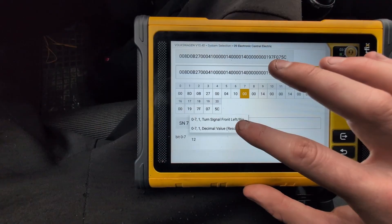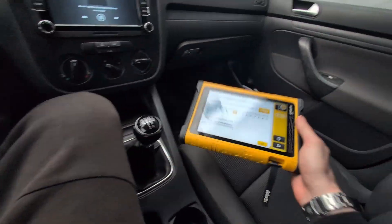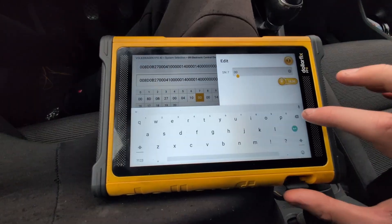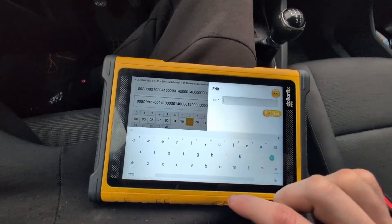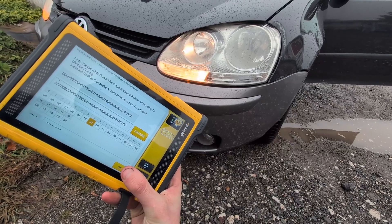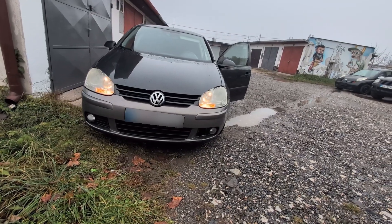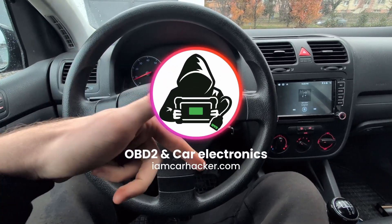Last modification will be in byte 7 — this makes US-style turn signals, so the turn signals will be on permanently. Let me show you my turn signals first. In this coding, what we have to do is change the byte value: 32 means brightness at 50% and 64 means brightness at 100%. For demonstration, let's do 64. So this was my five customizations with coding. If you don't have a scanner that can do coding, I have a list of the best scanners for VAG cars in the description. See you next time!